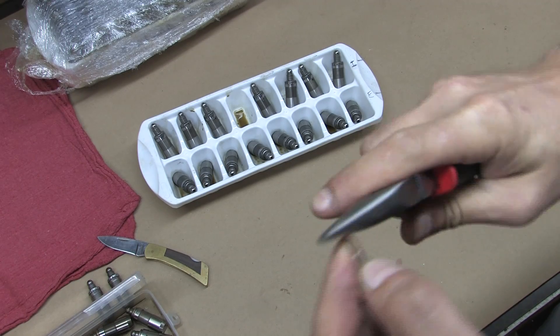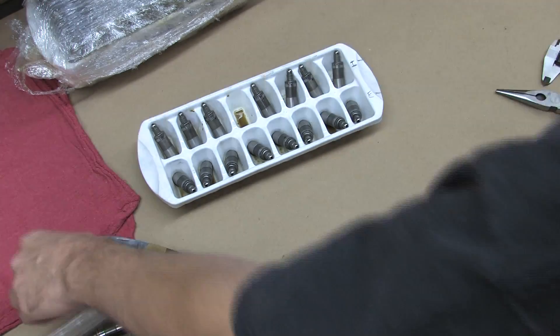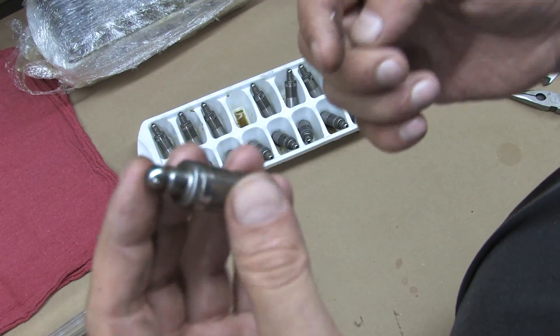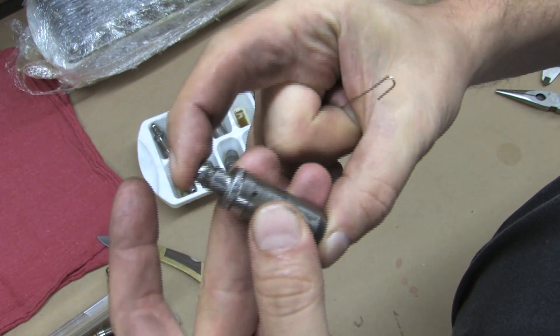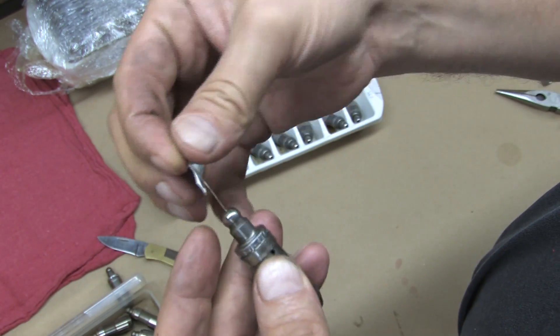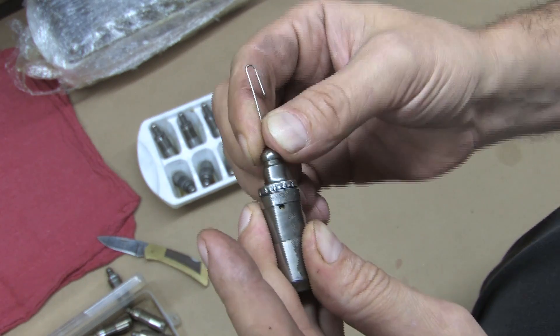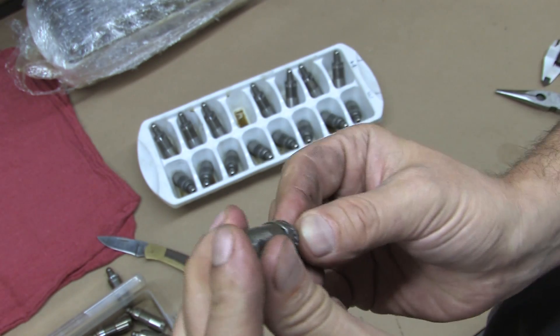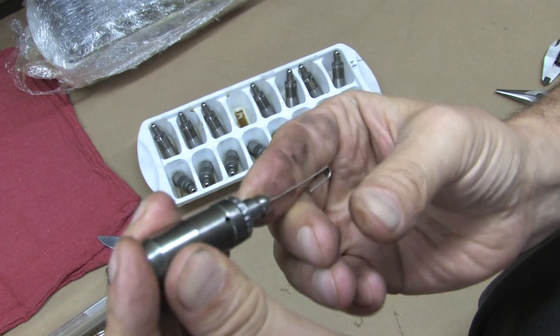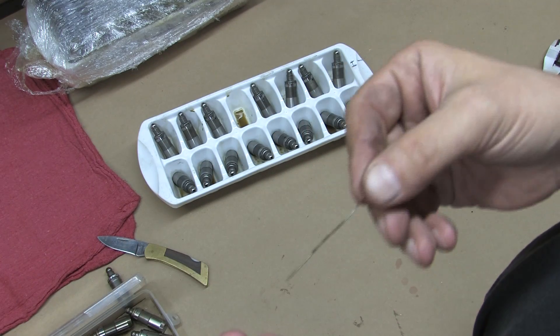Another way to bleed a lifter is to open the check valve — this is also the easiest way to free junk trapped inside the base of 2nd and 3rd revision HLAs. Just use a paper clip and make every effort to bend it perfectly straight; that really helps make hitting the check valve a whole lot easier. To actuate the check valve, insert it through the P-hole and down into the base of the lifter. Once you touch the check valve with it, you can pump the oil and junk out by hand. If you're cleaning them, turn them upside down when doing this to drain them, and right side up to fill them. It's that simple.